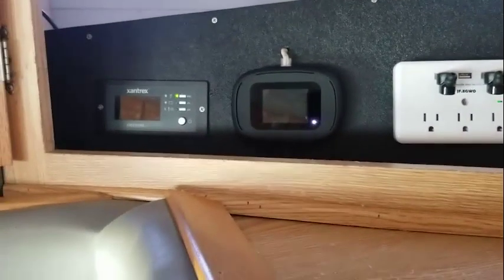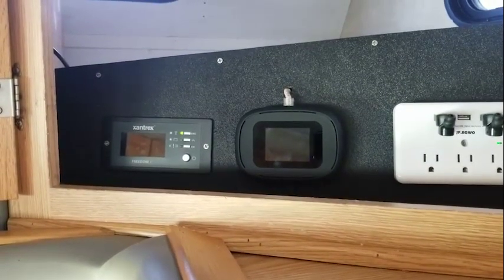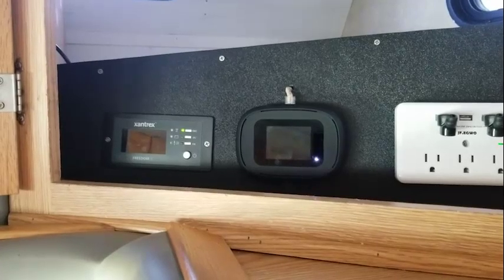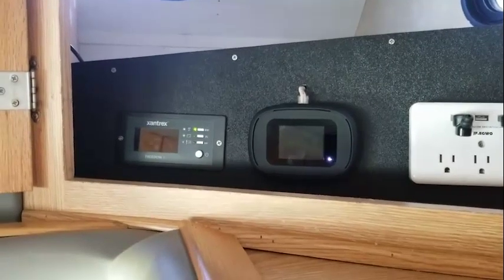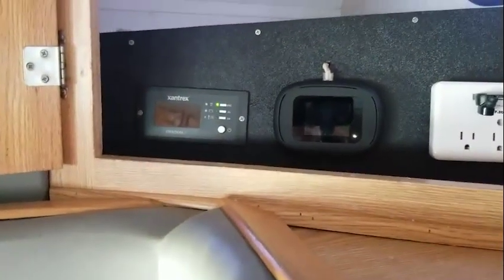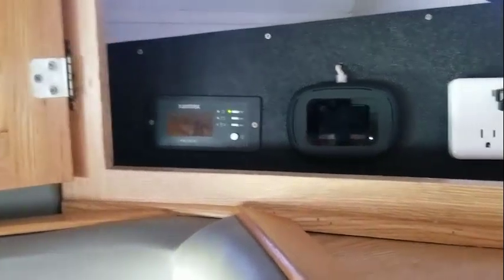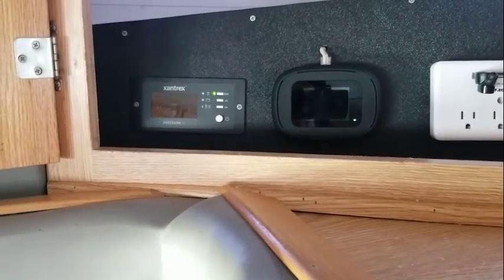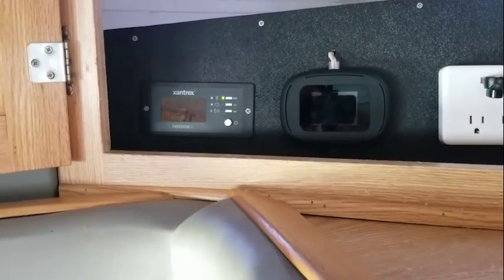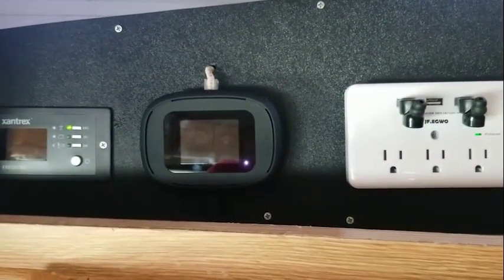To make all this work we had to have electricity and internet. You saw that we can plug in for electricity. If you're not stopped and don't have a plug, we put in an inverter which takes the batteries and inverts battery power to 110 electricity — so while you're driving down the street all these components can run. You can see quite a few 110-volt plugs back here, and that's throughout the whole motorhome. The inverter gets charged by the generator or the alternator on the car, and then the inverter converts battery power to 110 electricity so you always have power.